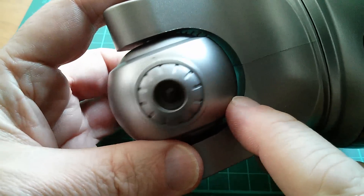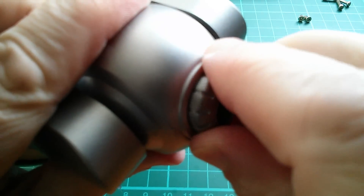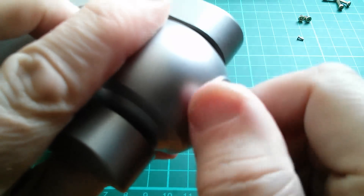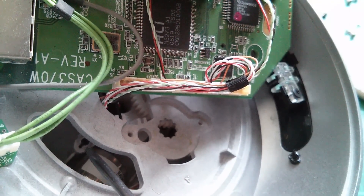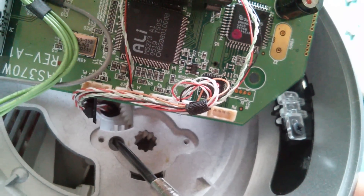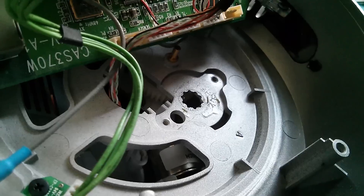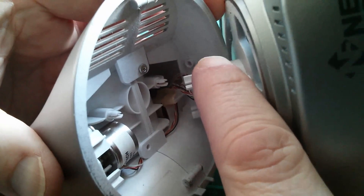The tilting head looks like it has a single screw in there, so let's take that out. I'm also going to completely unscrew the lens focus mechanism just in case that's holding the two halves of the case together. There are some tiny black screws which hold the top onto whatever rotates here, and I've got a feeling you access these through this hole under the stepper motor. These exposed pegs have to be squeezed — quite difficult with the camera in the way, so I'll do that off camera. That seems to have released the top part from the boss here.